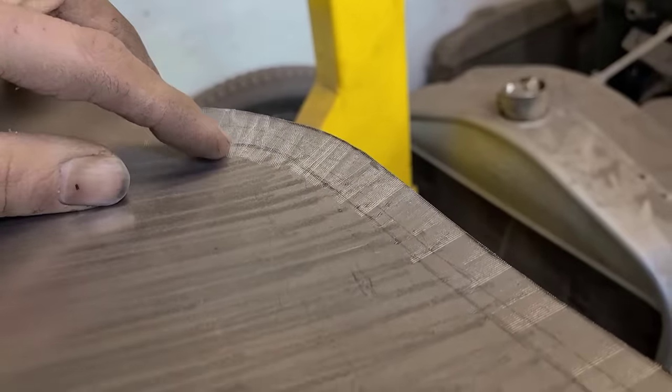And then this piece was kicked up like this after I shrunk it. So what I did is I just flattened it back out, and then I stretched all through here, and that allowed it to lay back down. I just stretched right along the edge. I didn't go too far in because then it might start doing things in the opposite way that I needed. So it's still pretty crude right now, but we don't want to get it totally locked in. We just want it to fit close to the contours of this, which it does.